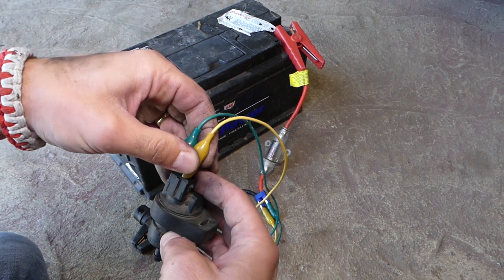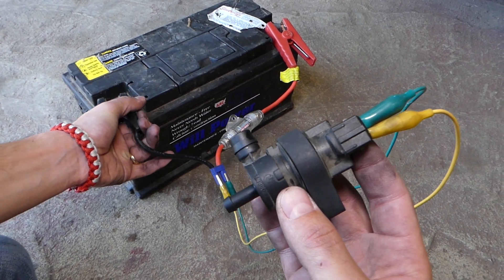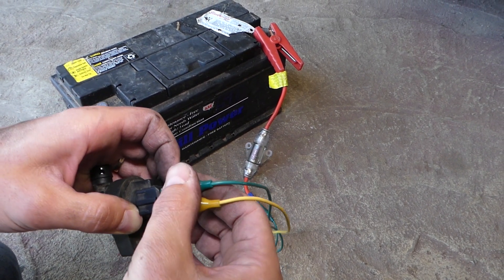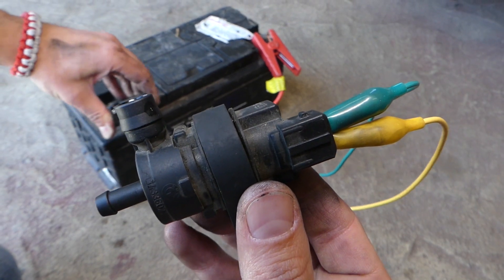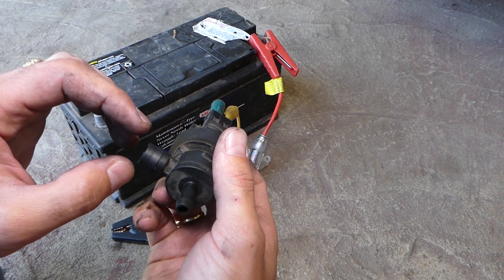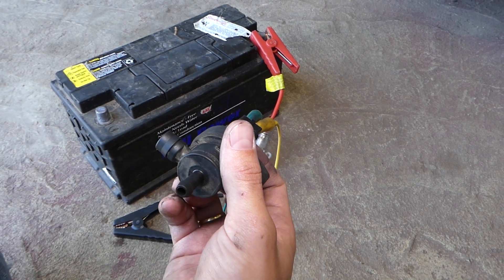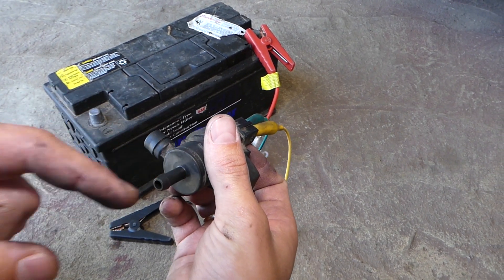Okay, I need to adjust the wires here. Listen now. It's moving a little bit, so let me just reposition it — there's very limited room and I want to insulate everything really well so I don't cause any damage. If I blow air from here, the vapors from the fuel tank come from here, and then they go through that hole out to the intake. When it's closed, if you blow through that hole, air will not come out of this one. I wouldn't recommend blowing with your mouth — use an air compressor. But when it's activated, the air will flow freely from this hole and exit this one — so listen now.